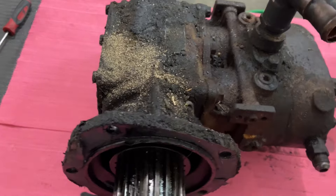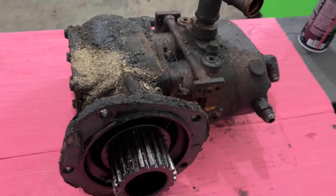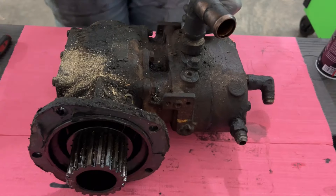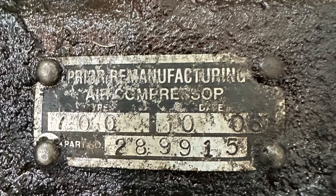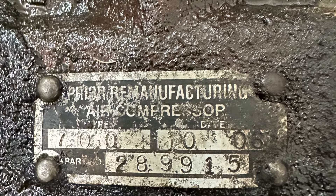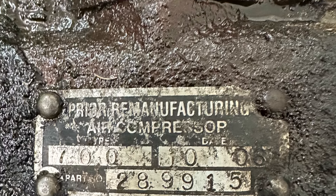I'm going to grab a half-inch wrench and take these little fittings off. This was just open — there was no hose on it, nothing. Getting through the rear engine access and getting in there, we could see that the air compressor had no clean filtered air for the intake. The hose had come off, so it's just been sucking dirt right through the compressor, which probably added to the wear and why it was passing oil.